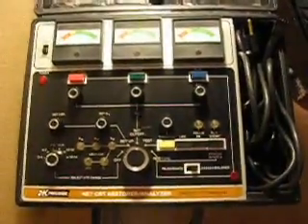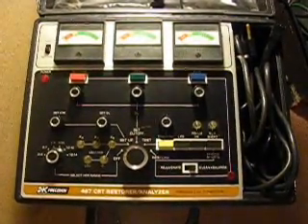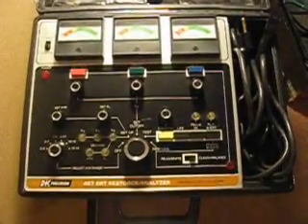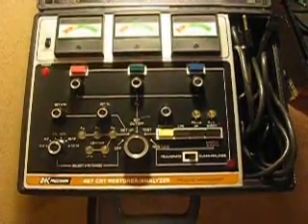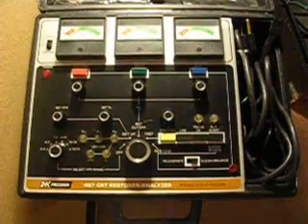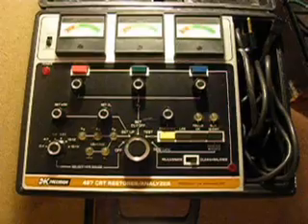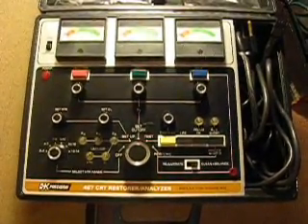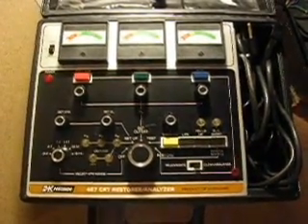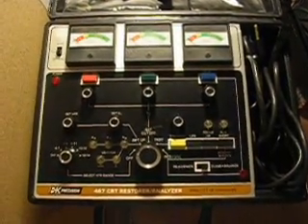This is a completely new process to me. I'm going to be referring to some online articles telling how to use the B&K testers. There's a chart on there that looks up even more modern picture tubes to show you what voltages to set for the heater and different things before you get started on the testing processes. These meters can do tests to the CRTs — the cathode ray tubes themselves — and fix some problems like shorts. There are shorts for the cathodes and shorts for the heater inside. Some of those it can fix, though I think the heater shorts it can't fix.